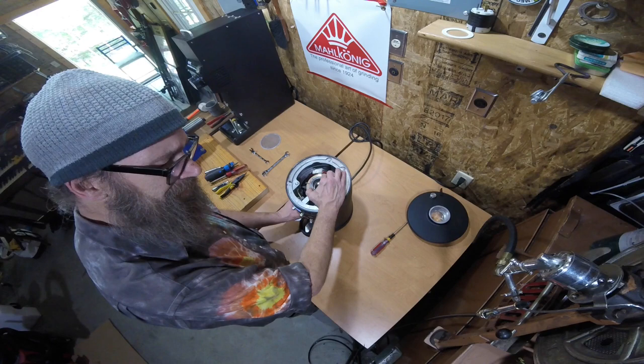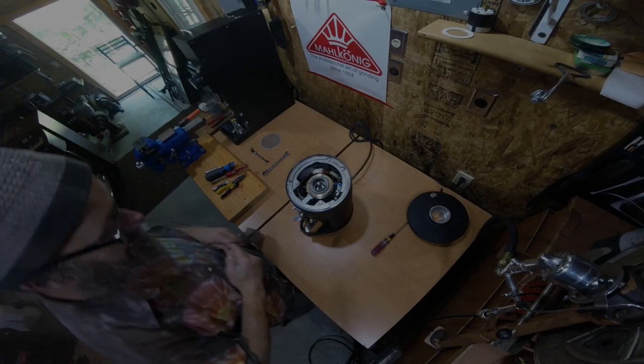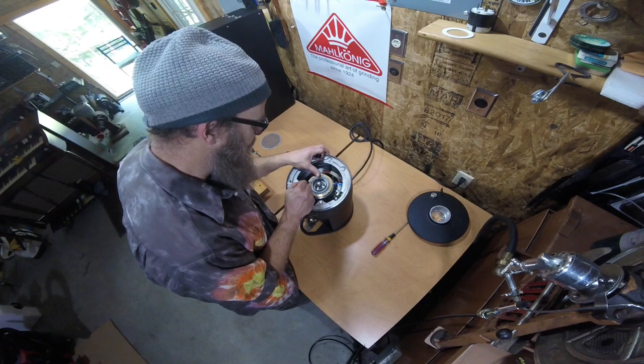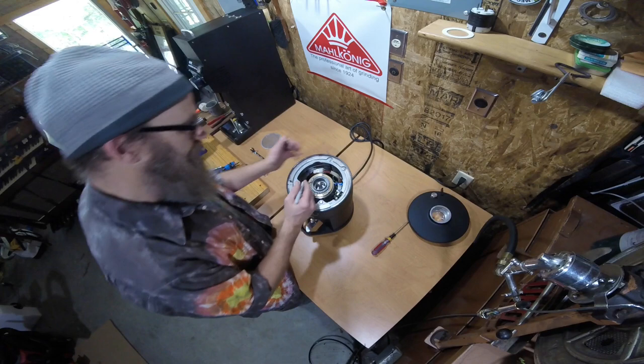Right there. Now we're going to make some marks in order to use for calibration. It just so happens some marks lined up in this case, but they might not be the last marks that were used. I'm going to make a mark on the cog, and then keep going from that cog straight off the piece of brass, so those two pieces line up.